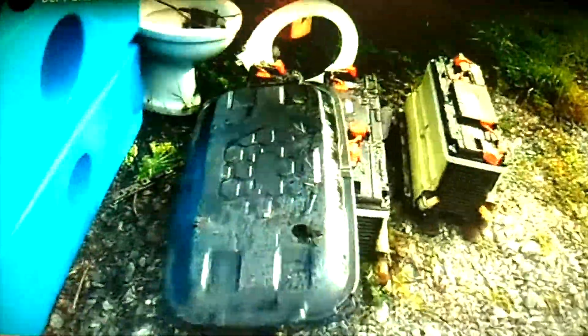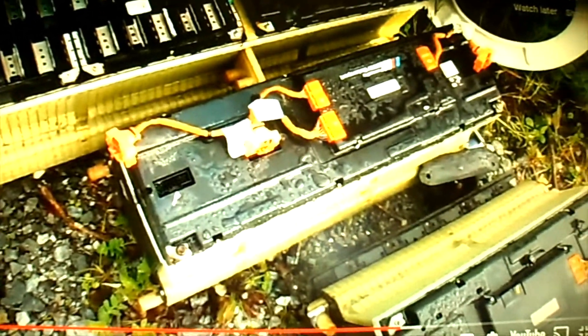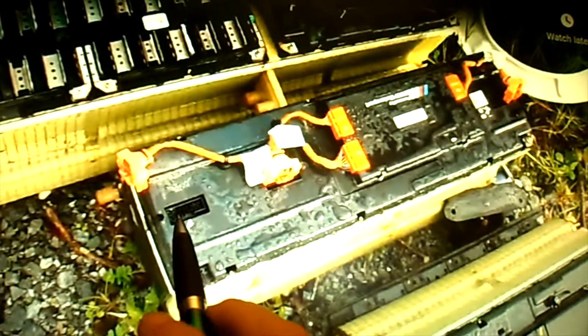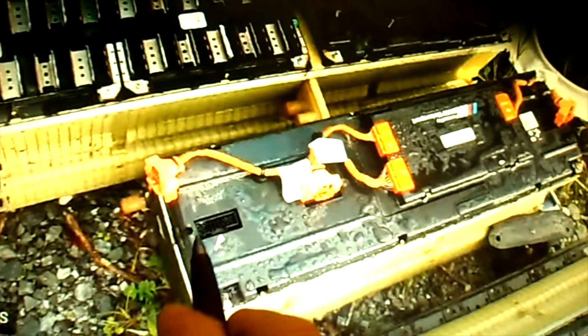Now the rain has decided to give us a break, so let's have a quick look. I put some fireproofing plastic over it, but this is the one — this is where the fire happened, right on the terminal block for the BMS harness. These things have been sitting out in the rain, and these wide-open BMS taps obviously would have got water in them. There haven't been any new fires, so maybe water isn't able to short these out — or maybe some coolant out of that blue hose could have.